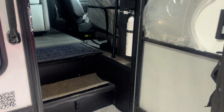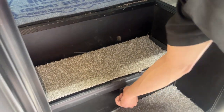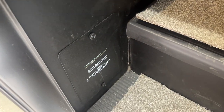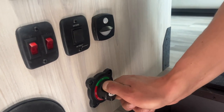Making our way inside of the unit here, the door just opens on up. This first step here, if you undo that and pop it on open, that's access to your batteries. Kind of right beside it is a battery control panel, so you have a bunch of relays and fuses back there — not necessarily for the unit, but for the truck. Battery disconnect switch here: pointed up, that's it turned on. If you turn it off to the side, that's it turned off, and you can see it kills your motion sensing light.